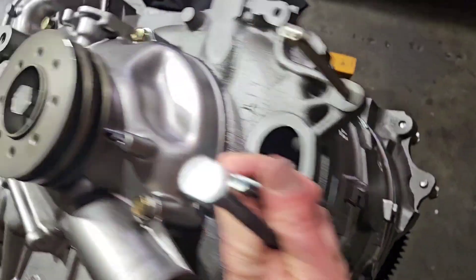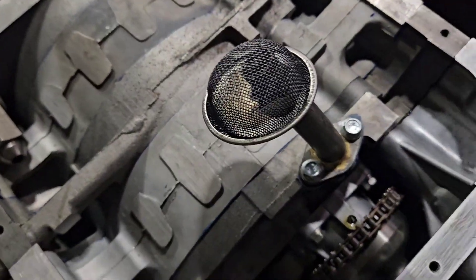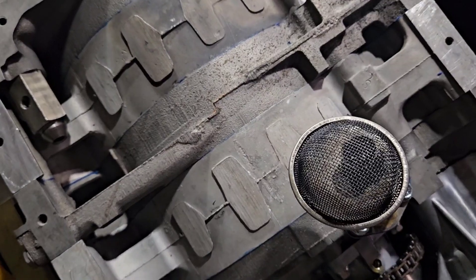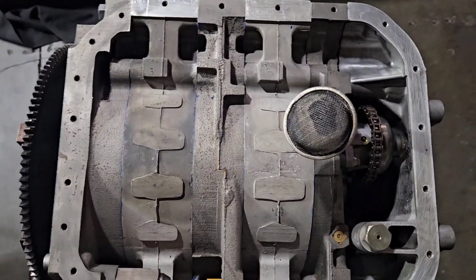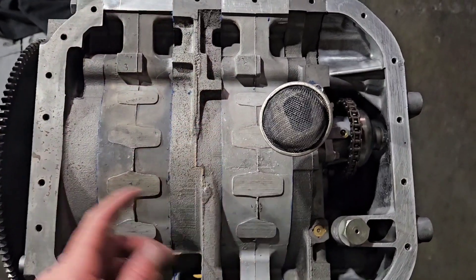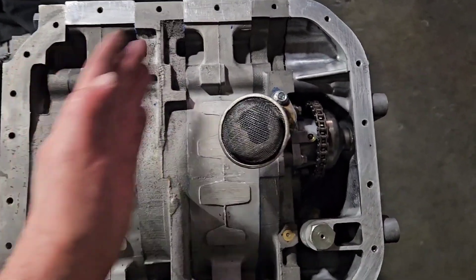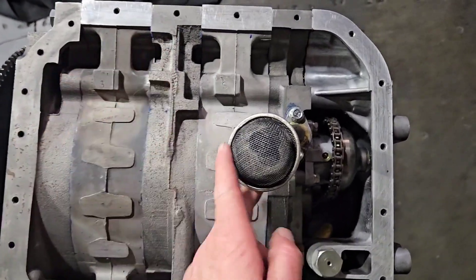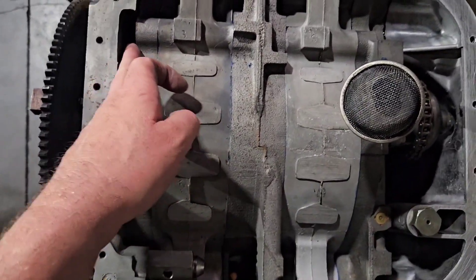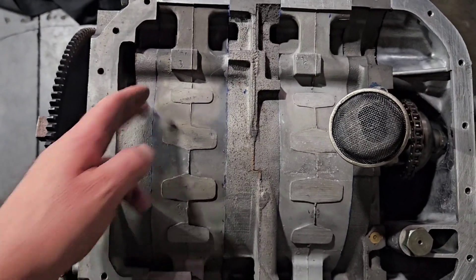Highly important on your earlier motors where the oil pans have absolutely no baffling internally. If you flip the motor over you can see internally — your oil is going to be draining back from the rear rotor and the front rotor through the different cavities, your middle plate, your front gear, and then your rear gear return right here.